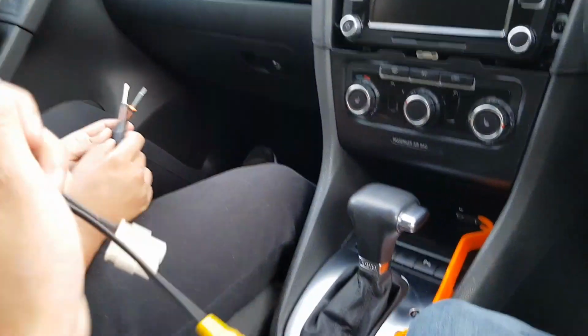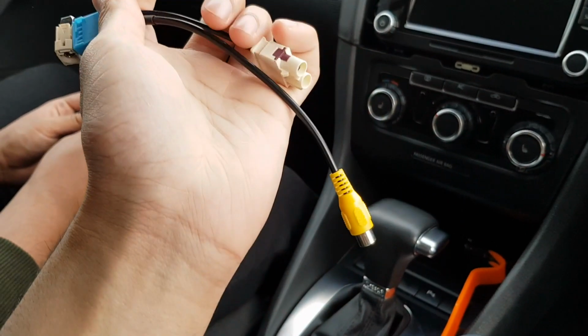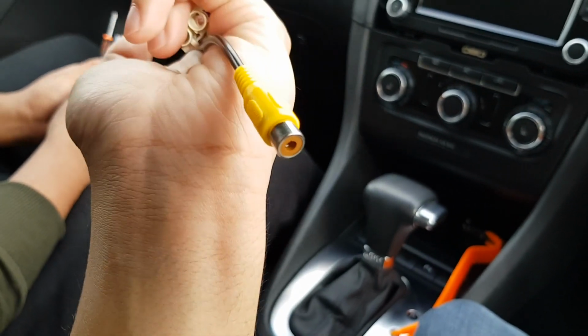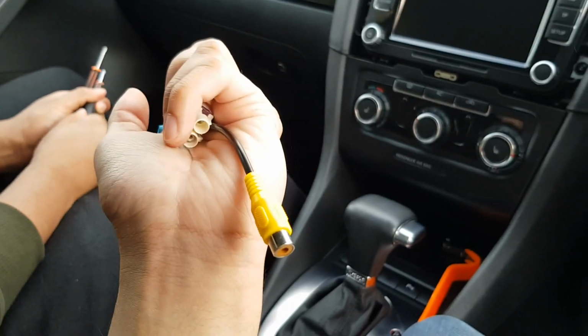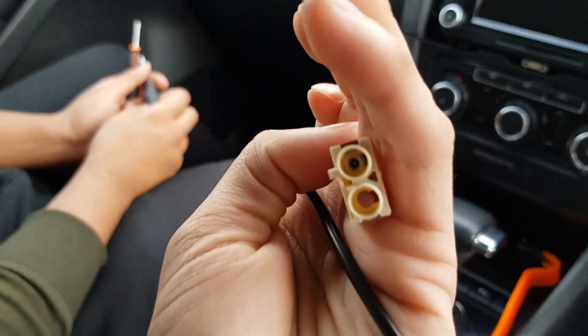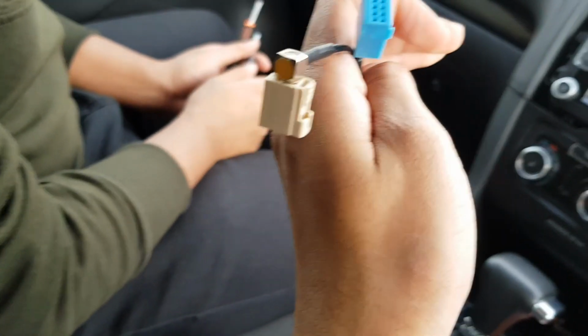And they give you a reverse camera thing as well. Let me just get them out, because we will need them. I'll show you how to set them up. Reverse camera one I won't need, because I've ordered a kit for that. This is only if you have a Chinese model one, or you put your own camera in afterwards. It won't work with Volkswagen's own system. But as you can see, there's 2 connectors there, and the one end goes in this.